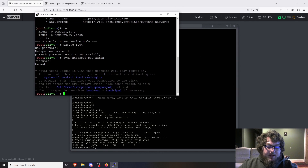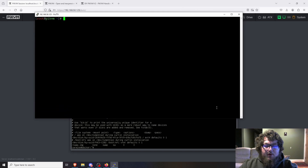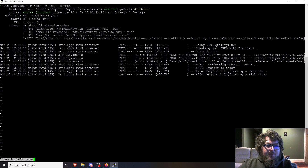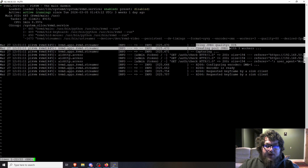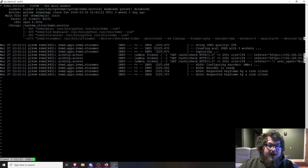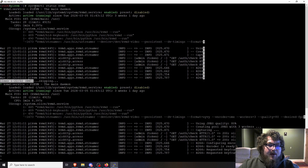One other thing you might want to do — if you're having trouble getting video to work as I did in the beginning — is run `systemctl status kvmd`. This is a built-in command to check Pi-KVM status. You can see the kvmd service is running, and it breaks down your different components. If there's a capture issue it'll say 'capture device not detected' or that it can't get the image. This was really helpful for troubleshooting.